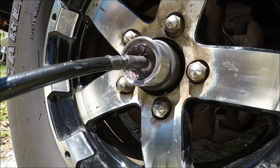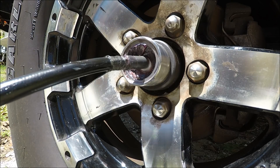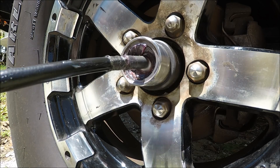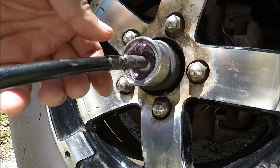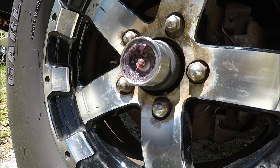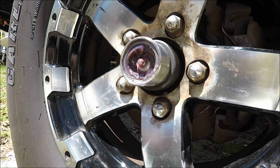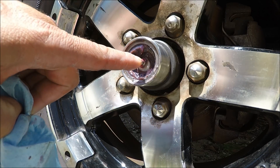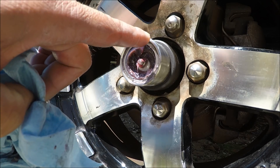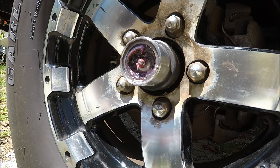You'll see the cap coming this way — the grease is gonna push the lid forward, so you'll see it when there's enough grease in there. You see the grease push the cap forward, so that will be enough grease there. With time, when that grease is running out, this cap is spring-loaded and it's gonna push the grease into your bearing so that way you always have grease there. I check this cap very often because when I travel to Miami I put about 600 miles on the trailer.